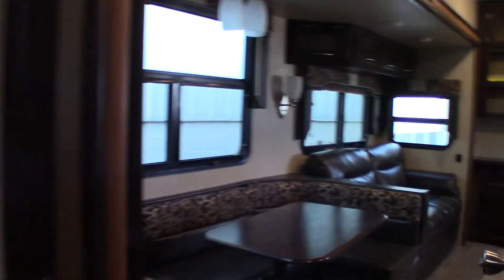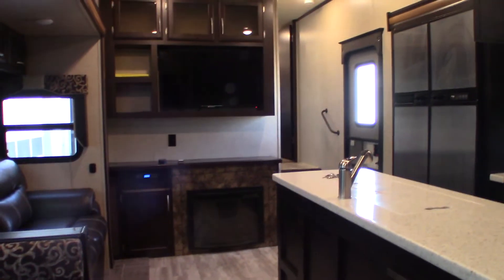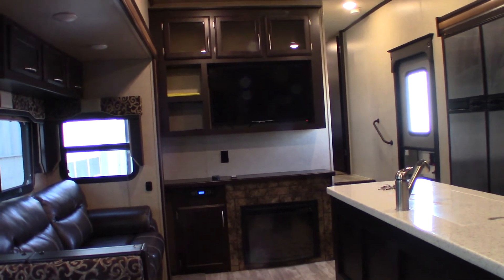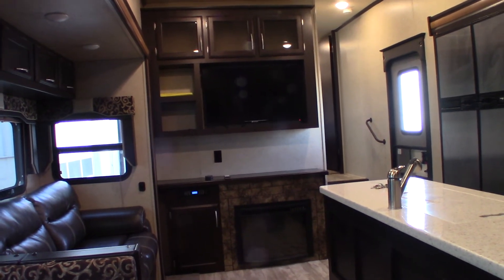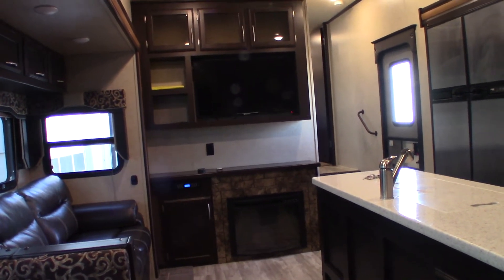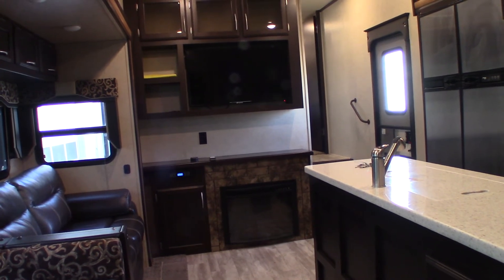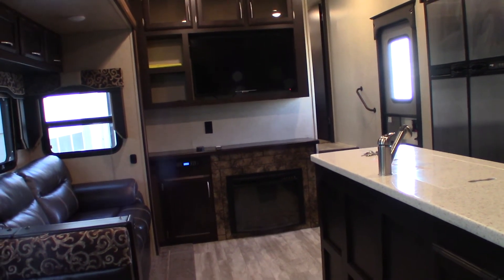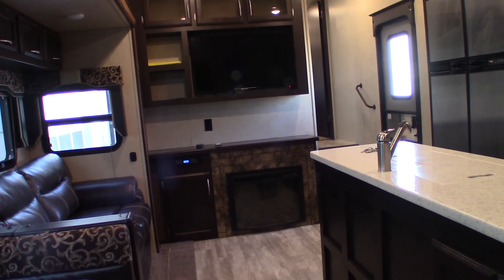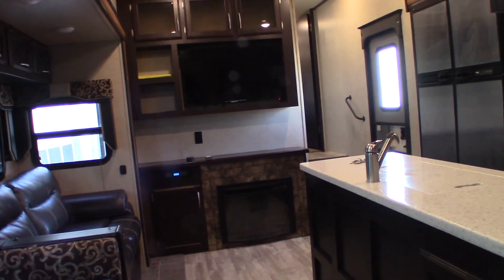Thank you for purchasing your trailer here at National RV Detroit. Remember what I said about inspecting the roof — that's important, a couple times a summer. If you see any issues with the caulk or sealant, or any damage from low branches, take care of it. Right now this trailer is winterized, meaning the water has been purged and replaced with antifreeze, and the water heater itself is bypassed and drained. It's all set for the winter.